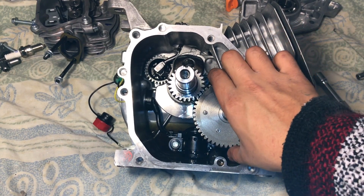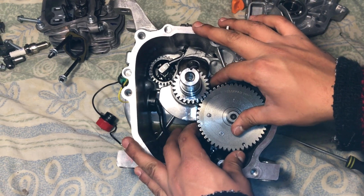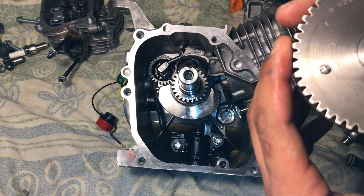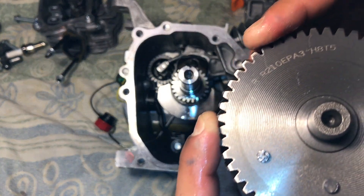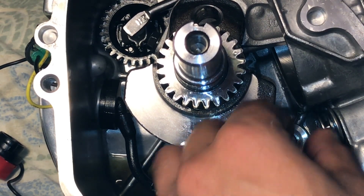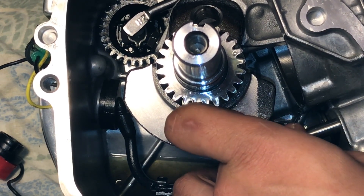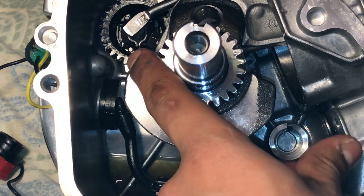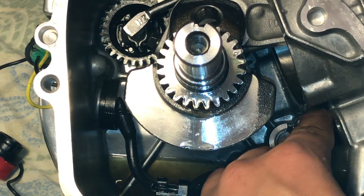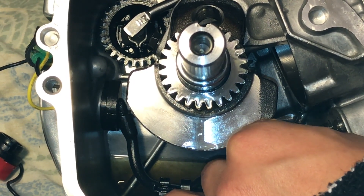Take your cam off — it's really simple. It's just one of those things you pull out. The way you put it back in is you're going to see two small holes on the teeth and one on the crank as well — that's how you line it up for timing. There's that hole and there's that small hole on the crank; they're going to have to kind of go in between each other. Next, take these two small pieces out and make sure you don't lose these tappets right here. Get both of them because they might just fall out.